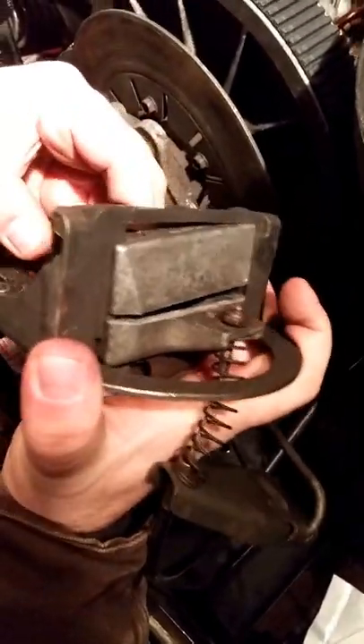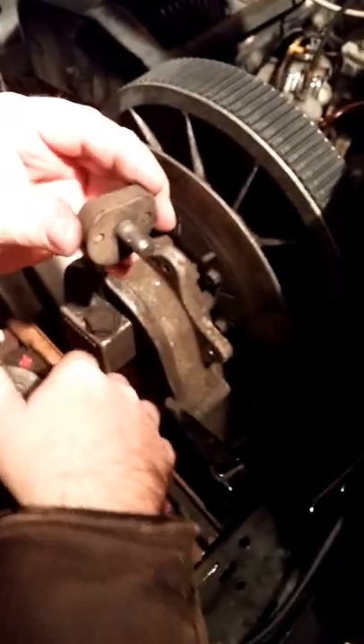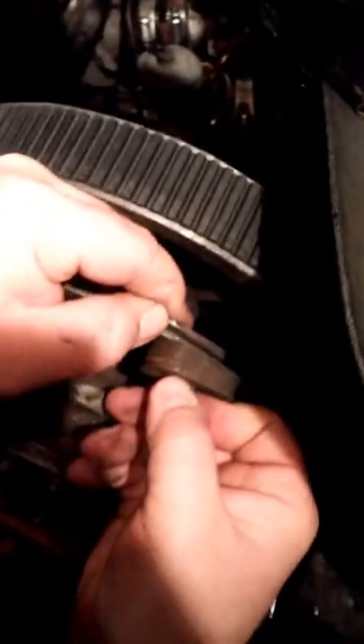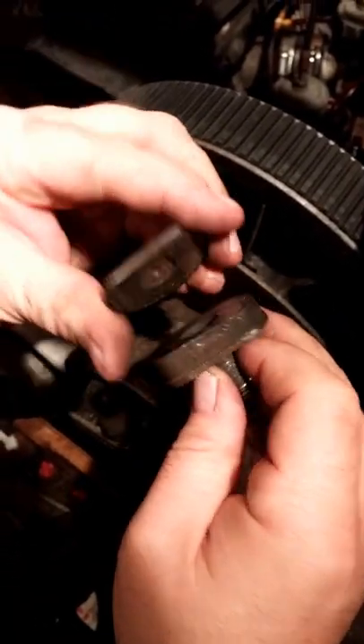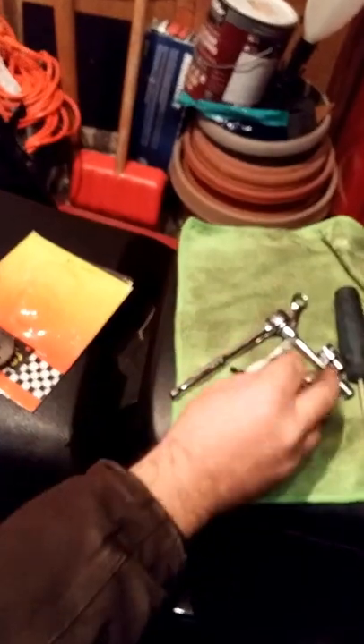The other pad on the inside is disconnected. There's an adjuster that comes out — a little harder to get out, twist it and loosen it. These bolts hold the caliper together — loosen those off and it's apart. You can see both sides, both pads. You should always replace them in pairs, so we went down to the shop in Newmarket and got our new pads.